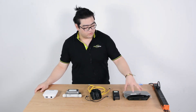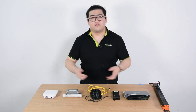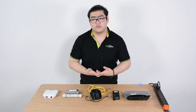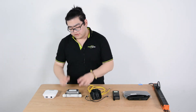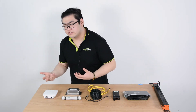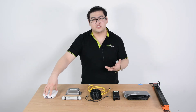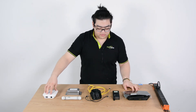Now first let's get our things ready: our router, an injector, an extender, and a wireless access point. The router provides us the data for our online connection. The PoE injector will inject power into our Ethernet cable — the data goes through the Ethernet cable to the injector, which injects power so it becomes a PoE signal. That PoE signal travels to our extenders — one is a one-input one-output extender, the other is a one-input two-output extender. These repeat the signal for another 100 meters, giving us a total of 200 meters. Finally it reaches our PoE wireless access point, which gives us Wi-Fi internet connection.